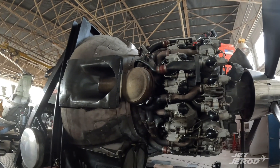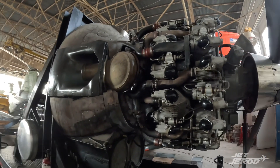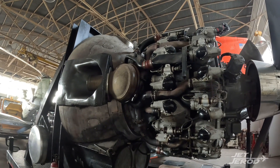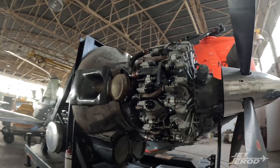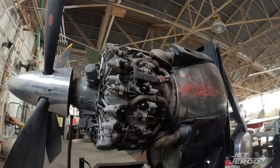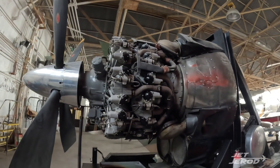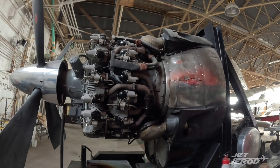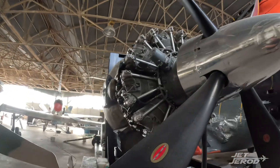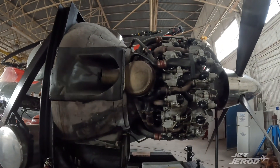That translates to an extra 500 horsepower by the time it reaches the propeller. Think about this — if you had a four-engine aircraft, that's 2,000 more horsepower on the same fuel consumption. At cruise, you're pulling the power back, so you get less RPM out of the turbine — about 16,000 RPM, or 200 horsepower per engine — that's 800 more horsepower on four engines on the same amount of gas. That means you can go farther, faster, and higher, allowing flights like Los Angeles to Stockholm or Tokyo to Seattle. This was the peak of the great giant radials before we moved into the jet age.